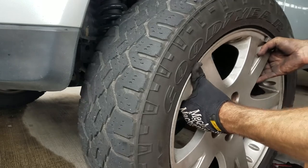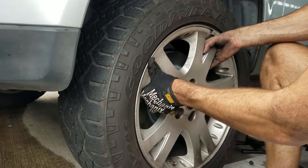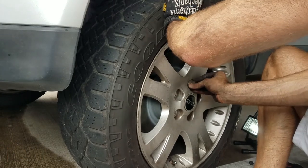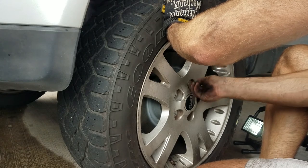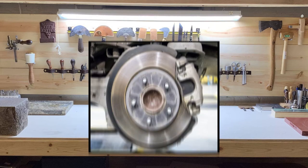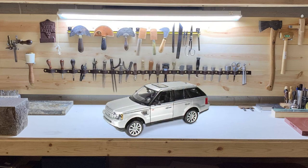Finally, return the tire and fasten the bolts. Remember to fully tighten the bolts once the car is actually on the ground. Additionally, remember to pump the brake pedal a few times after the job until you feel normal resistance in the pedal again. Pumping the pedal takes the slack out of the pistons as they engage the new pads. And that's it. Once you understand how to fix your own brakes, you can carry that skill over to many vehicles since the basic procedure will be similar. If you have any questions, please leave a comment. I make Range Rover Sport and LR3 repair videos as issues pop up, so don't forget to subscribe so you don't miss any simple fixes that could end up saving you thousands over taking it to the dealer. Have a good one.